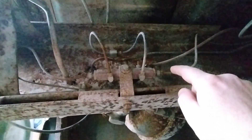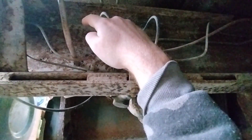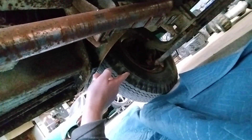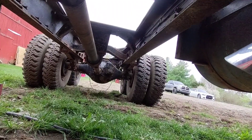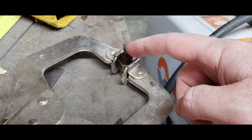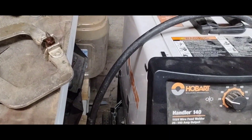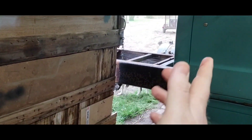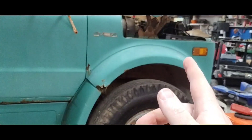So now we're underneath the truck, between the frame rails. This right here is the rear brake line — that comes up. This is for the parking brake. So my plan is, I think the front is good. I'm going to try to take off this fitting right here. If this line breaks, I don't really care, because what I'm going to do is weld this solid and put that fitting back in. Hopefully that fixes our issue. If we get front brakes on this, better guarantee I'm taking this down the road — something I've been wanting to do since I bought this thing. This is the fitting for that brake line that went into the master. I'm just going to flip the welder on, ground out to my clamp, and weld this opening shut. That way it will eliminate the brake system from the front back, and then we can see if the front actually works.